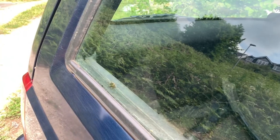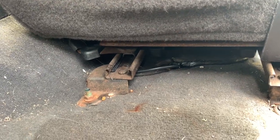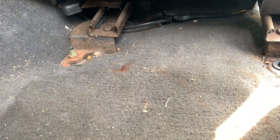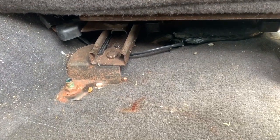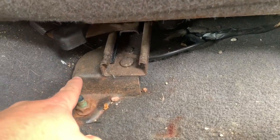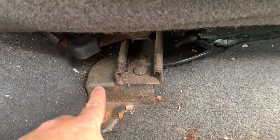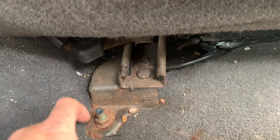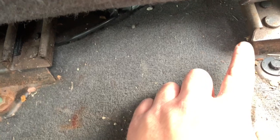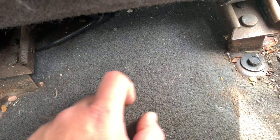Okay, this is underneath my driver's seat - obviously it's right-hand drive in the UK here. There's quite a lot of electrics and motors and stuff under here, but I'm thinking I can cut this bracket pretty much flush on this radius here, weld that back on, weld that bit back on here, same with this one, and then lower the front to the same amount. Should be good to go.